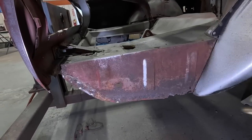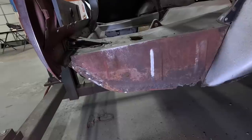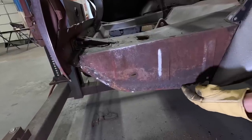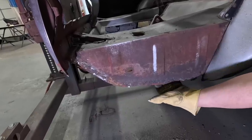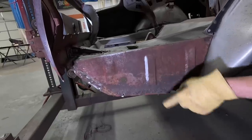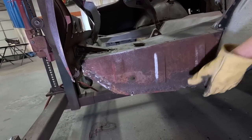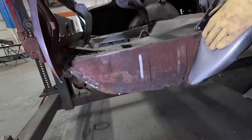This is the trunk drop-off. And then right here, you can see this hole is where the drain was originally. That's always rusted out. And this was rusted out, and this is why they replaced that quarter. Because all this was never repaired. And they just barely had it tacked there. Where you see the shiny spot is where it was welded. Never even painted. Nope, never painted, which I'll go back, clean all that, put a coating and a paint on it so it'll be better than it was. Which will be done before replacing the rear quarters.